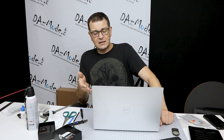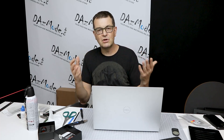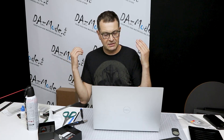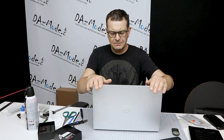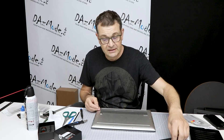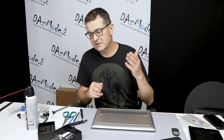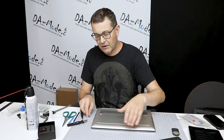Recently I started getting into the problem where the laptop basically kicks its fans as soon as I start up. I literally just launch my email, start downloading emails, and the fans go full speed. I check my temperatures and even if the laptop is just sitting doing nothing, it's already like 70 degrees or something — very close to 80 almost. When I tried to put it on a stress test, oh my God, it just took 10 seconds. CPU went into throttle because it hit 100 degrees. So essentially the thermals are complete crap.